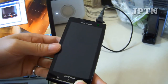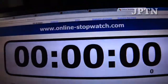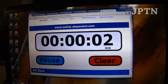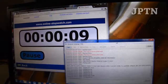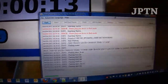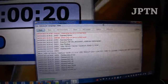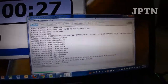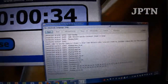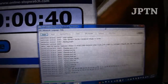You can always get into Flash Mode no matter what happens. The Flash Tool is going to pick up the ROM and start flashing. Flashing takes approximately 3 minutes, depending on the firmware. If anything ever goes wrong when you're modifying the phone or flashing a custom ROM or theme, just go into the Flash Tool and flash the phone again. Flash Mode loads up before any software, so you can always get into it. If your phone is not recognized, it means you're missing drivers — install PC Companion and Update Service and make sure they're updated.